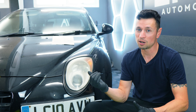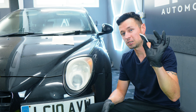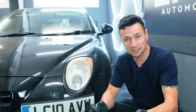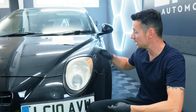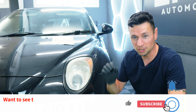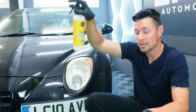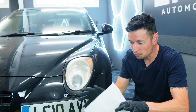The instructions also say you need to tape up around the light, because the last thing you want to do is cause any damage. Think about it — we're using sanding discs. If you got carried away, went a little too quick, and caught some of the paintwork, if you didn't have the knowledge or resources, you'd be in a bit of a pickle. For a beginner, it might cost a lot more to repair a sanding mark on your bonnet than restoring the headlights. So no, tape is not included with this kit. The instructions also say you're going to need a cup of water and a clear spray bottle with just water in it. I've got some spares here, but I'm just saying — if you're buying the kit and think you're good to go with just the drill, there are just a few more things you need to be aware of.